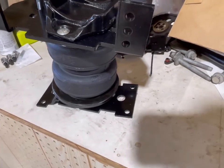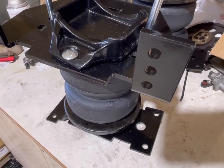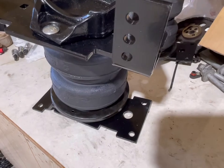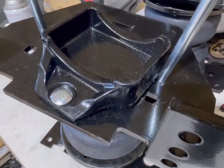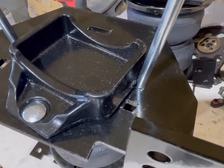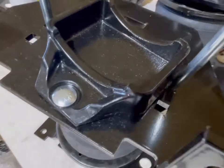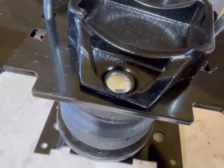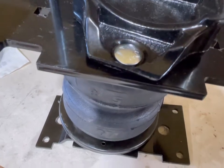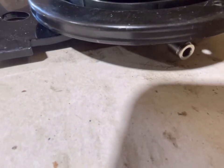All right guys, here we're on the bench. This truck — we're doing it on a 2017 F250 without the rear sway bars, so this is how we set them up. It does not matter what style the bracket goes on. You'll use the long hex head carriage bolts here, from the furthest from the flange — you'll use those holes. Like I said, it does not matter on this one; these parts are universal. If it does have sway bars, you obviously have to change up the holes. Your valve is actually on the opposite side, so make sure this flange here is opposite your valve.